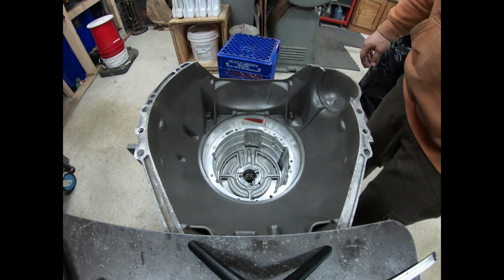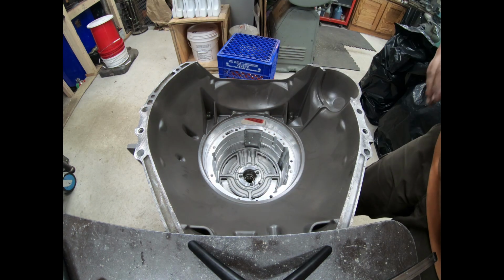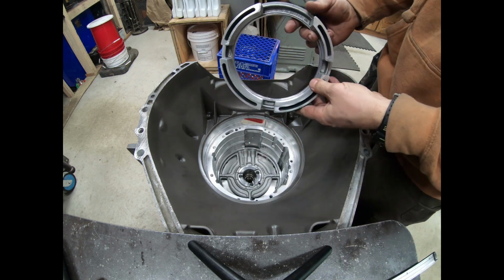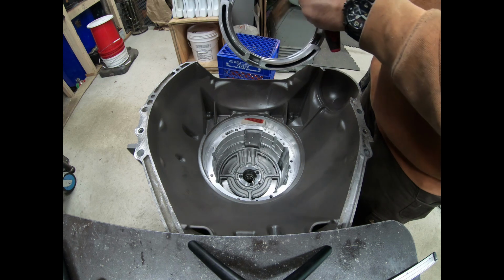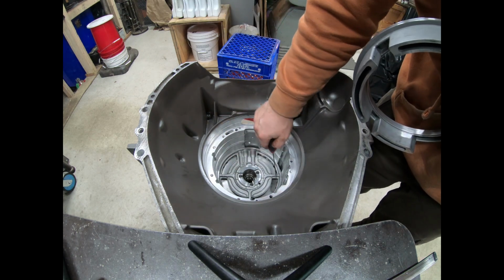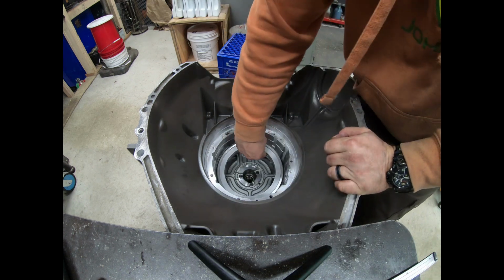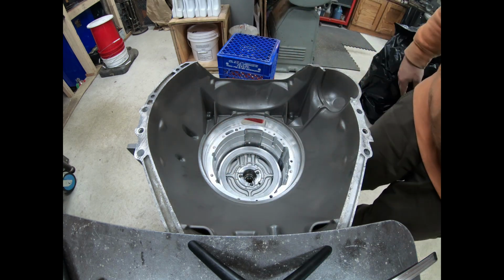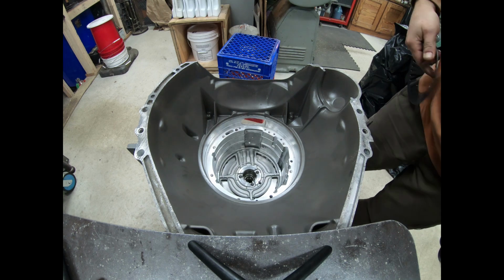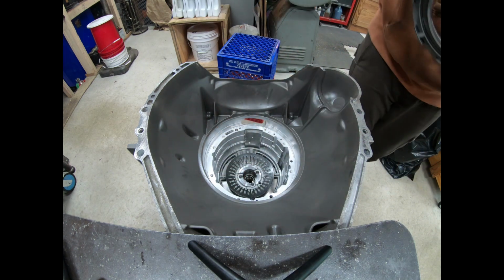All right, we're all aligned with our bolt holes. We haven't done anything to affect the location of the center support. So now you can see here, this is the intermediate piston, and these surfaces here pass right through the center support and sit right on top of the intermediate steels. Just like that. So I'm sitting right on top of the intermediate steels. All right, I'm gonna put an intermediate overdrive piston assembly in here, and we're gonna take a look at our alignment.